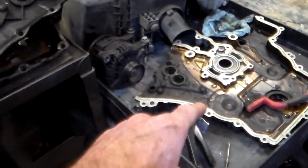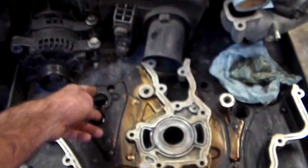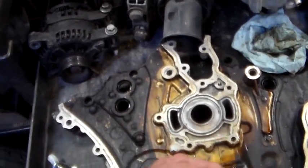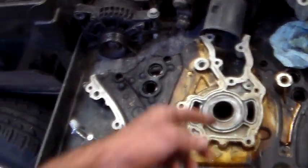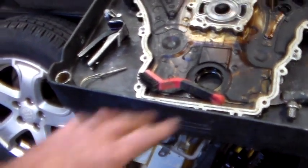Tomorrow I'm gonna work on cleaning the nose up real good — underneath those there is a package that's got a new front main seal. These are where the camshaft actuators for the variable timing are, and I believe there are seals for those. There's also a new seal for the backside of the water pump and a new seal for the front side of the water pump.